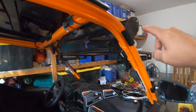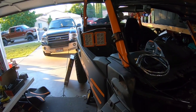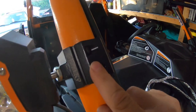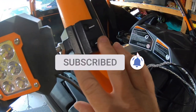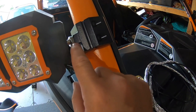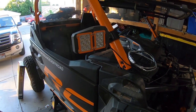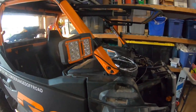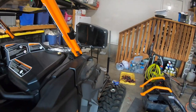I've rewired this light bar here twice now. I'm going to have to rewire my lighted mirrors and pull the power to that block. These are actually Super ATV mounts made for the Profit cage for the Polaris and Can-Am. The clamps are great — it's got a threaded hole in there, but I had to drill it out and re-tap it to fit these mirrors on. Other than the price of the mirrors and the price of the brackets, these were $50 for two of them. The mirrors are okay in brightness and okay in quality, but they're not $200 okay. That's my biggest gripe with them.